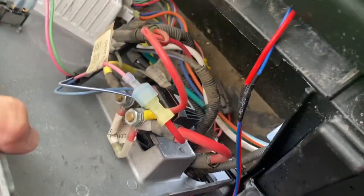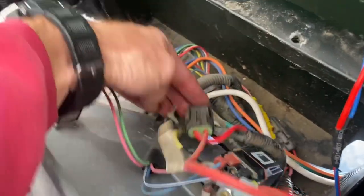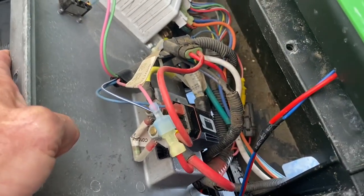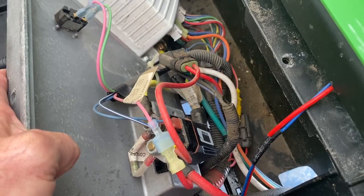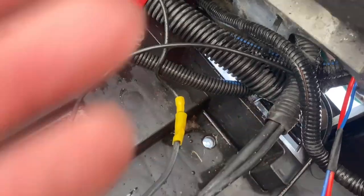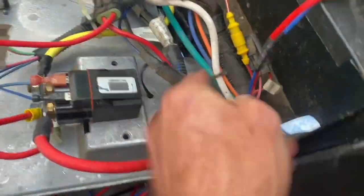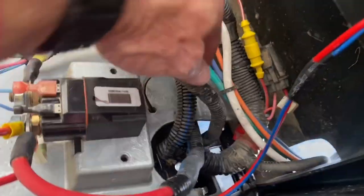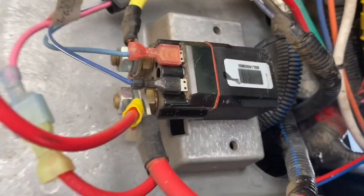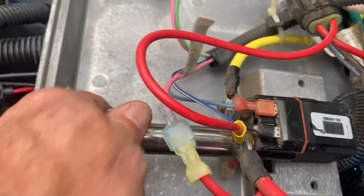This wire right here is the wire to my charging port, which is going to come out. I'm going to find out where it comes in the back — it comes in right here. I'm going to find where it connects and totally take it out. I got it laid to the side. There was a zip tie down here that connected all these cables together and I just cut it loose — no big deal. This wiring harness here is the one that goes to everything. This red lead goes around to my solenoid, so I'm going to take that half-inch screw loose.